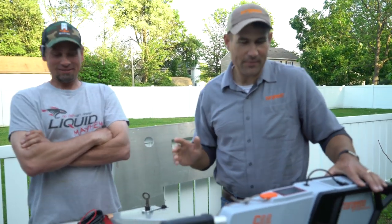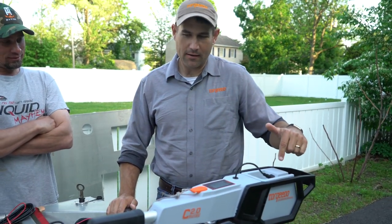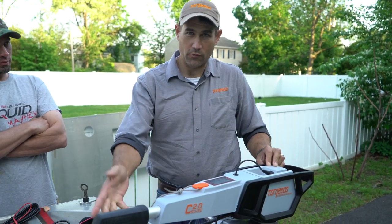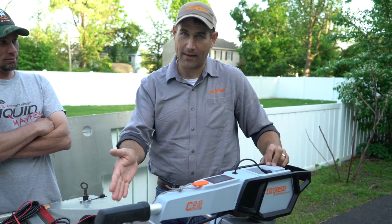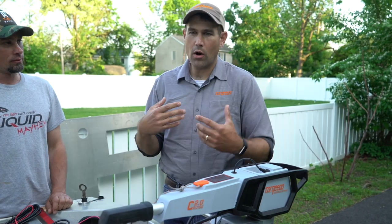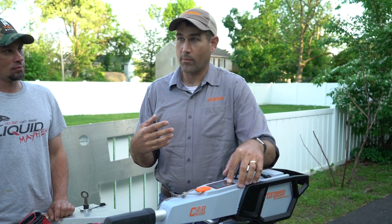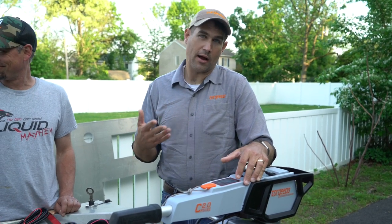Yes. The good thing about the Torqeedo system is it communicates with the Power 26104, the battery, to know what percentage, how many watt hours are left in there. It has data of how fast you're going in miles per hour, and whatever your current throttle setting is, you always know how far you can go, and it'll display on the throttle your remaining runtime at whatever throttle setting you have it at, so that you know you're not going to run out of juice. You're not going to be left stranded.